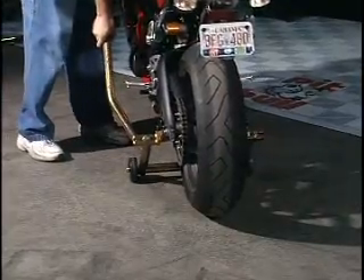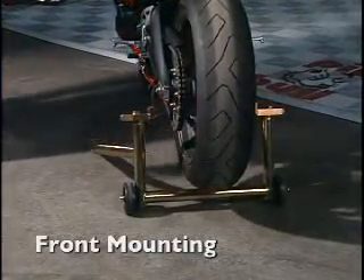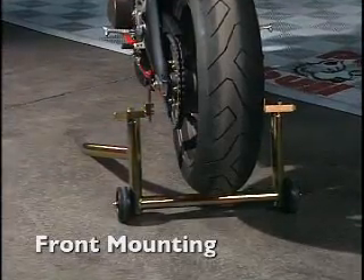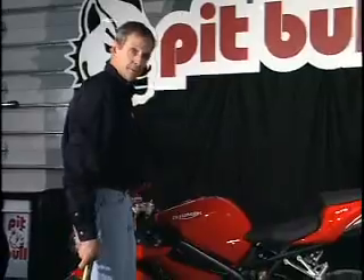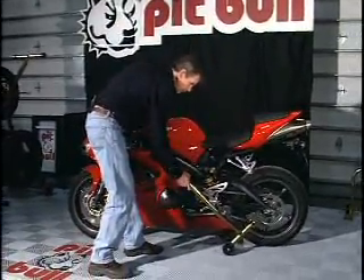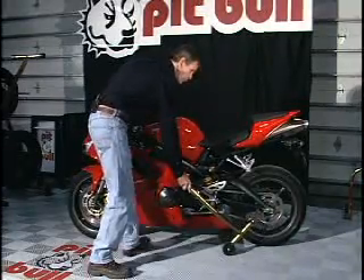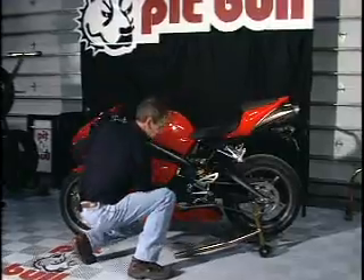All this requires a quality stand, or any means that will fully support and lift the bike for wheel and/or suspension removal. With the forward-handle rear stand, you can hold the hand grip of the bike to stabilize the bike. You bring the stand into place, hook the swing arm, then you push down on the stand to get the bike up.